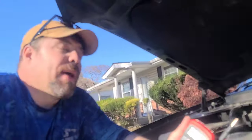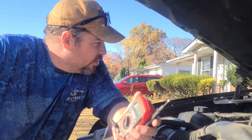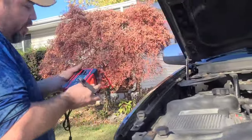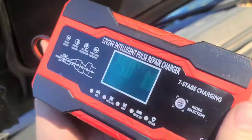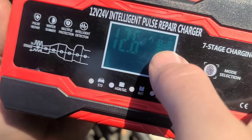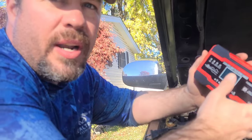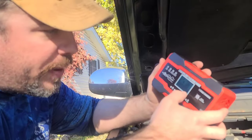It's working — I'm a little sad. I mean I'm happy; I don't want to put an alternator on, they're expensive. I've got to figure out what's wrong. I'm going to test my battery — it is running a little low. I have this intelligent charger and I always use it because it gives me a good range. I'm at 12.6 now, but when I started it was at 60%. The battery got some charge sitting there, but it went from 60% charged after sitting since Friday — that's two days and it lowered power. Shouldn't happen that quick.